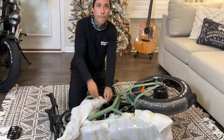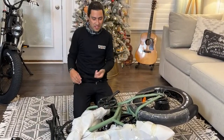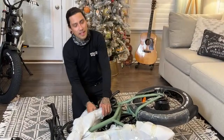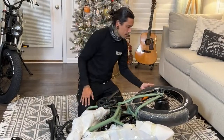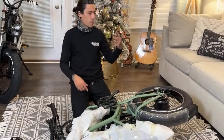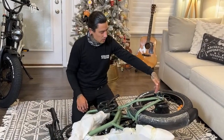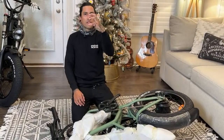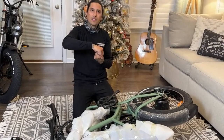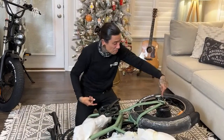Yeah, so are you going to tell us what was the problem with the last bike? I'll tell you afterwards, because I can show you them next to each other and you can see there were a few things. I can tell you the derailleur was totally messed up, not tuned right. Also, when the back wheel was spinning, the cassette, all the different sprockets, the whole back was shifting like that when the back was moving. So I don't know if that's the, damn it, what's the name of that thing? Little metal thing that goes through. It's like bent inside there. There's a metal piece that goes through. What's the name for that?